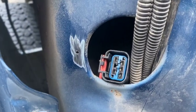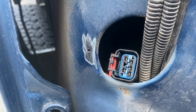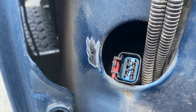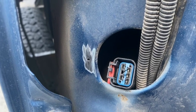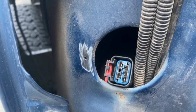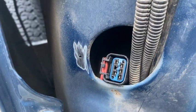I took my grinder and cleared off a little spot so I can get a good ground. Just a tiny little punch — it's pretty thin metal so it punched right through — and that's where the self-tapping screw they included can go. Be careful you don't drop it down there; I did once and fished it out with a little magnet.